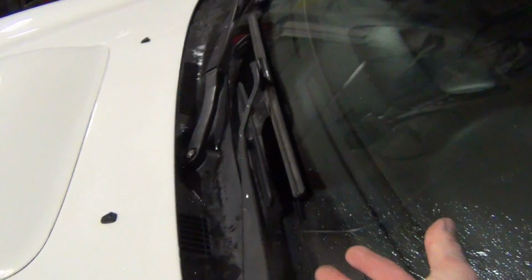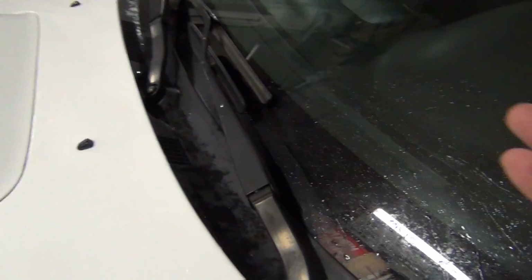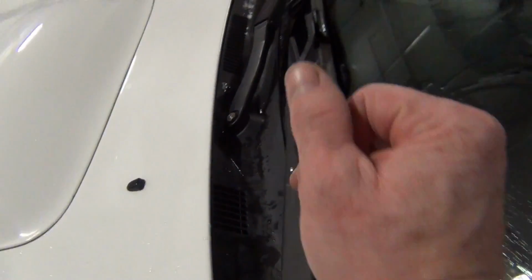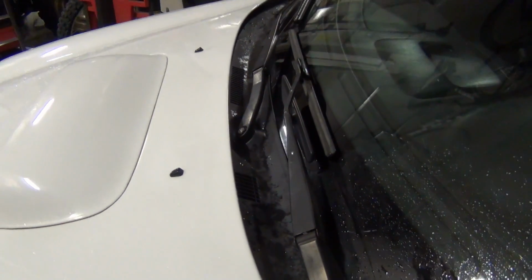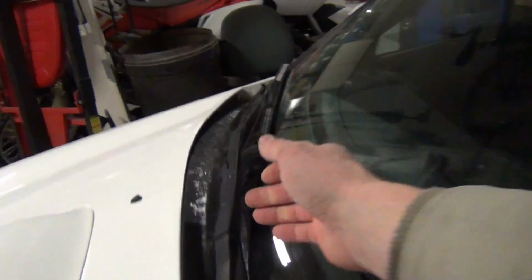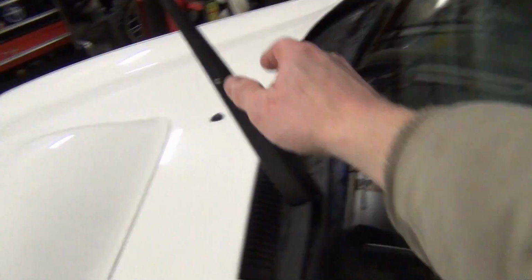So now that it's fixed, we got to talk about why that little joint by the wiper motor got loose. And the reason why is this. And really for cold freezing temperatures. When these freeze down, that thing's muscling and smashing against the bushing as hard as it can to get these things to break free. So you'll notice if you go skiing, a lot of cars will have their windshield wipers up like this so that they don't freeze to the windshield. This way you can scrape it and get it all good, or defrost it, do what you gotta do, and then you don't have that problem.